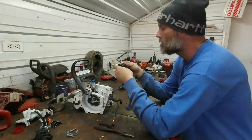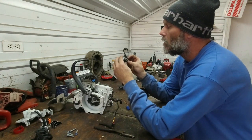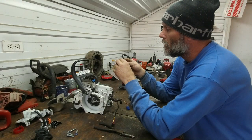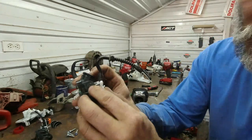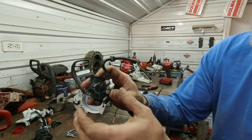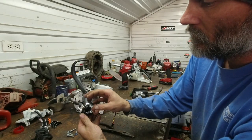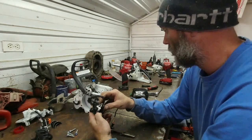This looks like a one piece. I might be able to pop this cap off, but I don't want to risk ruining the injector itself. I'm assuming there is an O-ring in there, right here, educated guess. Looks like a fuel pressure regulator. It's vented to atmosphere around here, and I can see there's a diaphragm with a spring. So as the fuel comes into the unit and circulates, it keeps a certain pressure to keep the injector feeding the appropriate amount of volume per pulse opening, that the ECU controls.